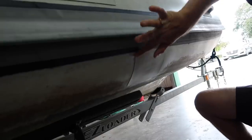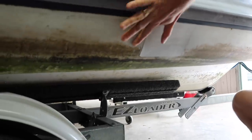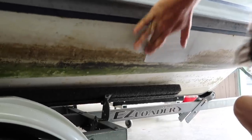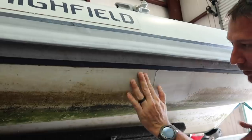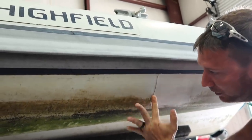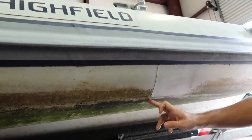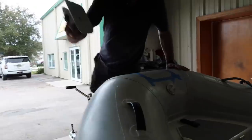If you let all that old glue dry on there, it'll turn mustard yellow and look like crap — that's why you need the acetone after. But wait until everything's cured because if acetone gets underneath the patch, it's just going to peel back up. Wait until tomorrow when it's cured, then take the acetone to get the remaining glue off. It'll look so good that the only person who knows there's a patch there is you.